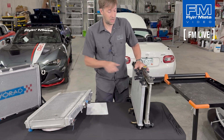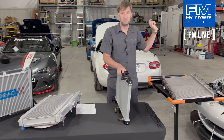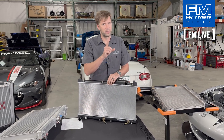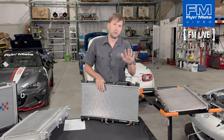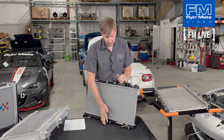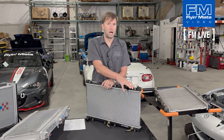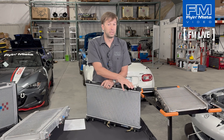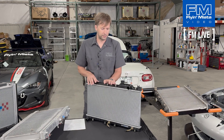A Mazdaspeed radiator — which is basically this but without the transmission cooler — does have the thicker core, and it's actually one of the best-performing radiators outside of our crossflow. So this is a really good budget option. If you need something cheap and have a little bit of increased load but not a ton, and you're okay with replacing it in around 10 years, this is a solid choice.